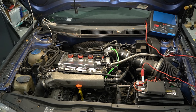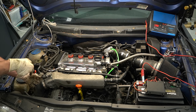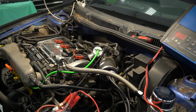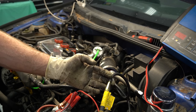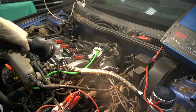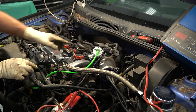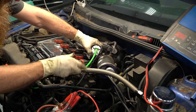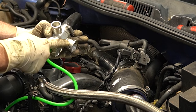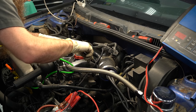Next, I'm going to hook up the smoke machine and smoke the entire intake stream. This is going to pressurize our boost hoses and allow us to see if we have a boost leak, mostly at that one that is down below — that's my main point of concern. Let's see if we get any smoke coming out of this setup. This is where our pressurized air and smoke mixture is going to come in. This is blocked off and we're going to smoke this entire thing. There is a ton of smoke. Now we've got to find where the heck it's coming from. I'm going to take this blow off valve off and block it out to eliminate that as a potential place for a leak. Hopefully the car is actually tuned to have this blow off valve. Typically these are tuned for a diverter valve, which recirculates the air back into the intake instead of blowing to atmosphere. Pulling this off, I noticed there's a bit of a nasty spot here on the hose.